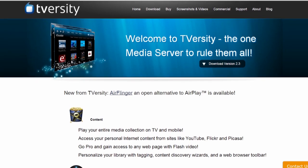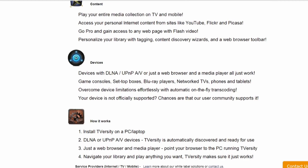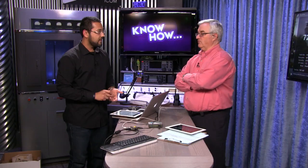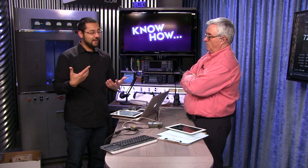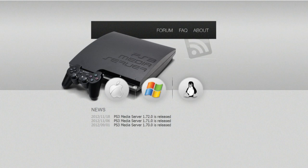If you like giant video files over a gigabyte and want to use a Raspberry Pi at each TV, I suggest getting a transcoder. Check out T-Versity — it's $4 and Windows only. You run it on a PC that's on all the time. It'll look at your media files, transcode them, and send the stream to the Raspberry Pi, so the Pi doesn't have to do any decoding. There's also PS3 Media Server, which is free and allows any device that handles UPnP or DLNA to see the content — you can transcode from Linux, Windows, or Mac.